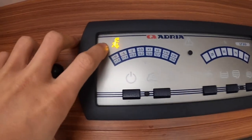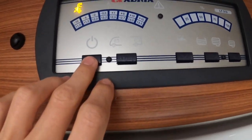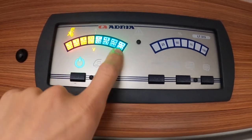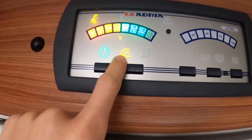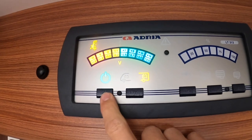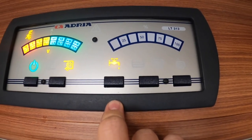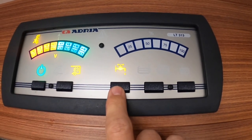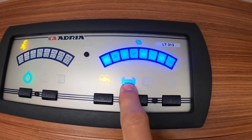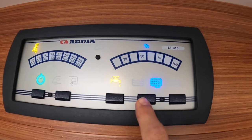To operate your control panel: you'll see the icon indicating mains hook-up is on board and you're receiving 240 volts. Turn the panel on by pressing 'on' — it will then tell you the voltage of your leisure battery. Click again and it will also tell you the voltage of the vehicle battery, which is 13 volts. When hooked up you'll get 240 volts; if not, you'll just get 12 volts off your leisure battery. Your pump needs to be on to pressurise your tap, toilet, shower and hand basin. You'll hear the pump kick in, pressurising until it cuts out, then it'll cut back in when you open a tap. Click here to see your fresh water level — 100% water on board, and zero waste shown here if you had any waste on board.